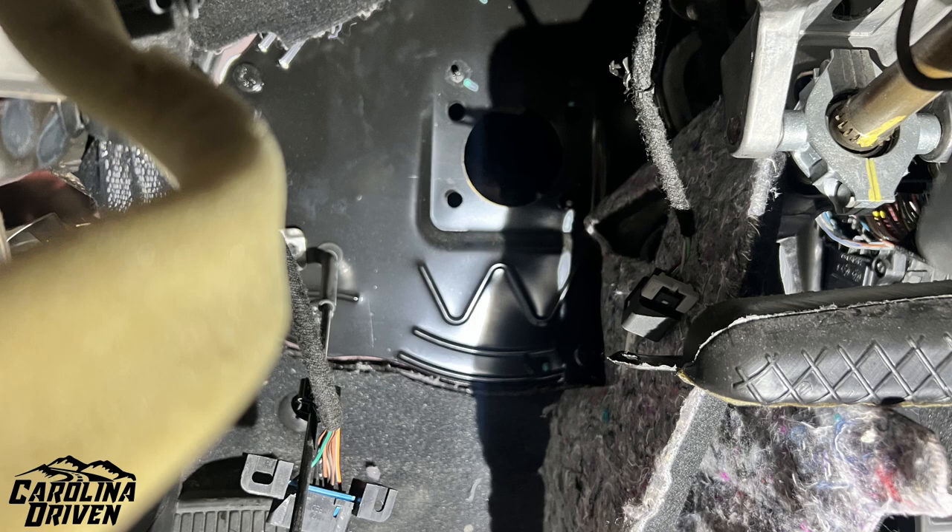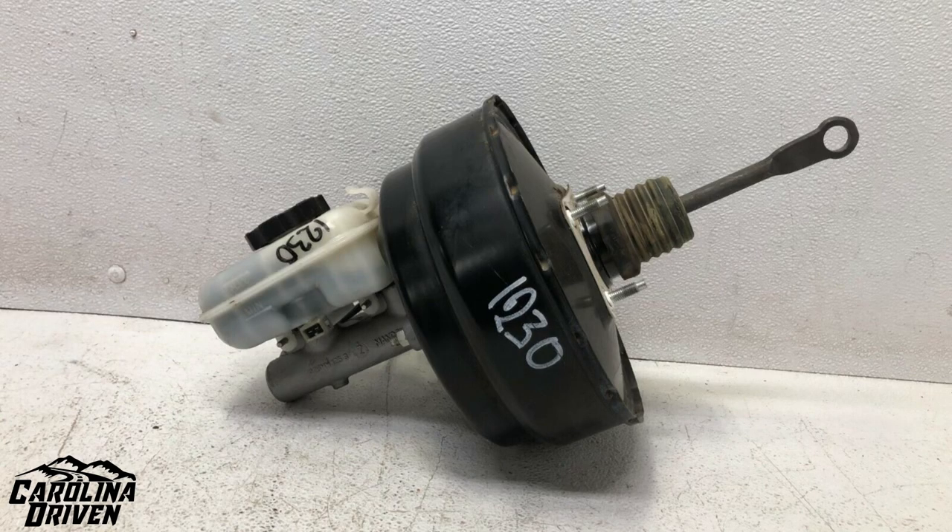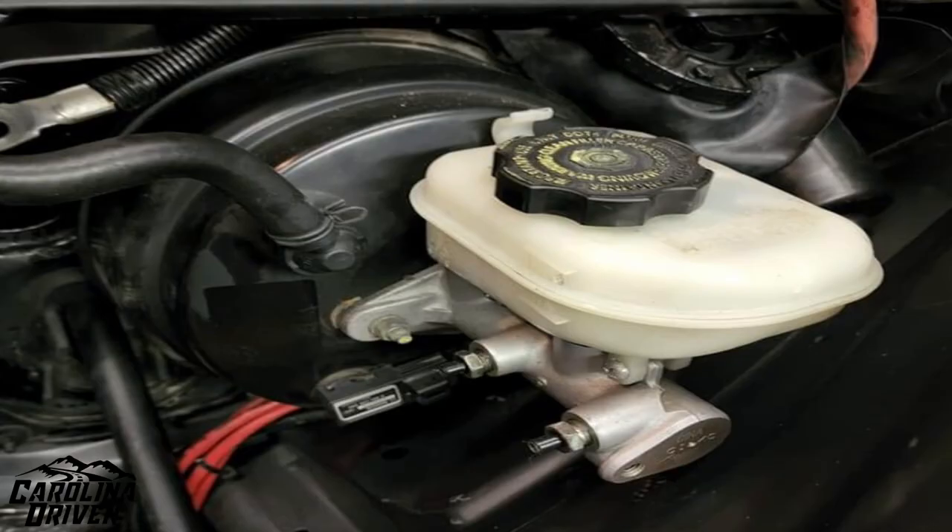Once you do that, you're going to have to go outside of the car. The next step — and I personally would suggest it, though it was 50/50 among people I asked — is removing your braking equipment right there at the firewall. I personally would do it because you are drilling so close to it, plus you can also see where you're actually drilling. There's a horn, the brake booster, the master and everything right there, plus a wiper motor. You'll be able to get your hand in there if you pull all that stuff out of the way.